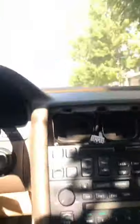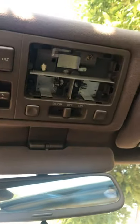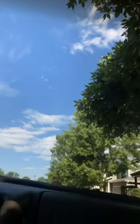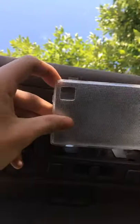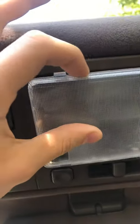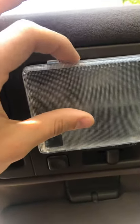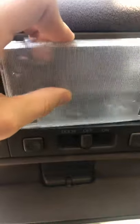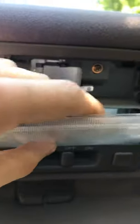For your dome light — there were absolutely no videos on it, I had to look it up, so I'm gonna give you a rundown on that. The way it sits in there, there's a little notch right there — that's where you're gonna work your pry tool in. Be very careful, work it down or out. Once you get it down a little bit, stick your pry tool in the rest of the way and slowly work out each of the sides until you get to the last two, which are just hinges, and then you just pull it out.